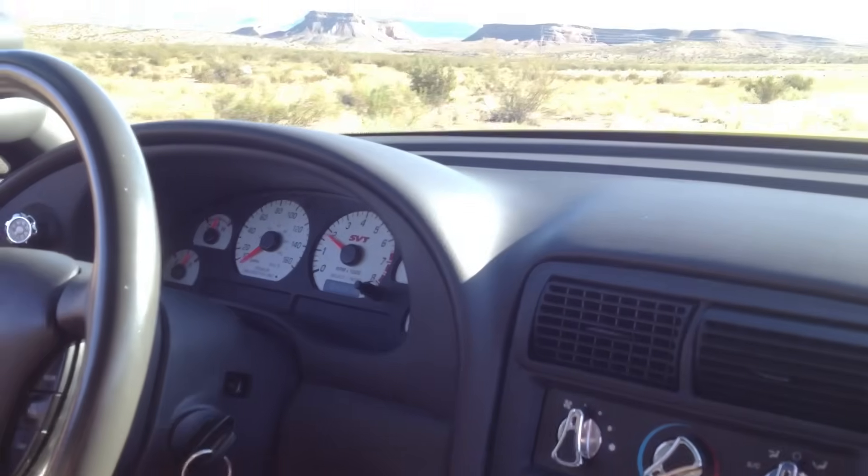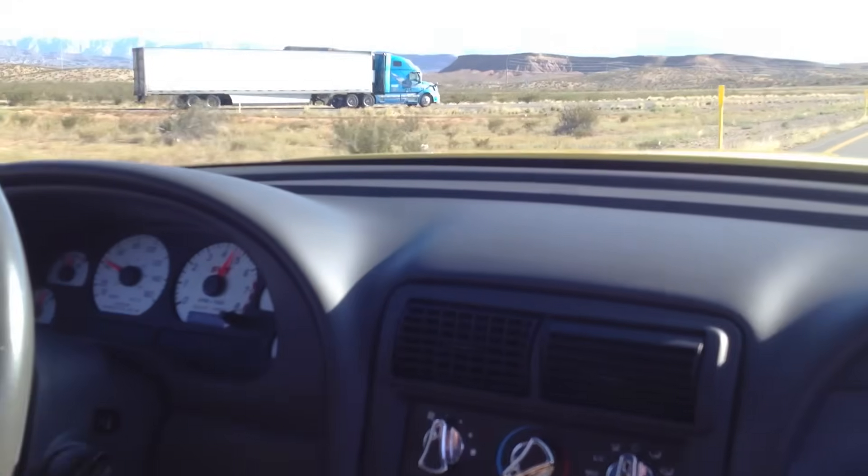Independent rear is more for track use as far as a circuit track — not your straight drag strip, but your autocross and that kind of thing. As far as driving on the street, I really like the independent rear suspension on my Cobra. I don't take this car to the drag strip often and launch it hard. I actually like the IRS quite a bit — when you roll into the throttle it squats really nice and you can feel the flex in it. It's a really good setup, even in a straight line, as long as you're staying out of dead launches with sticky tires.